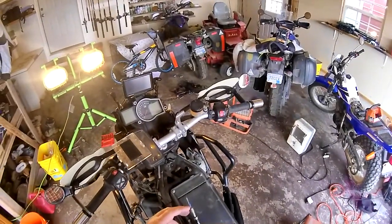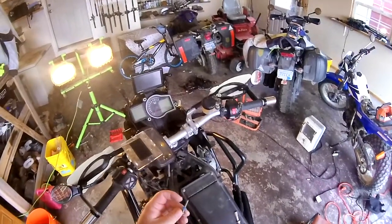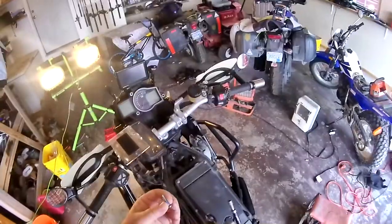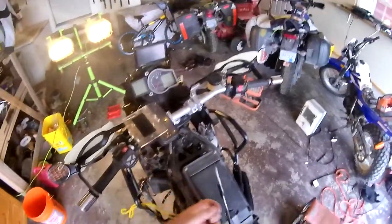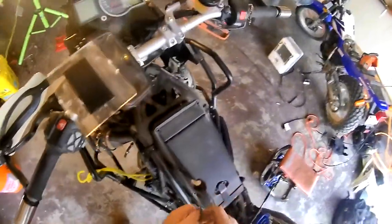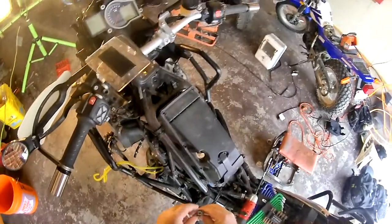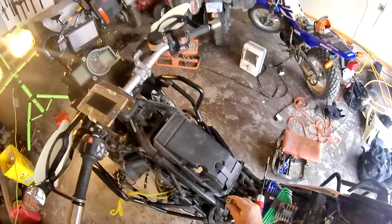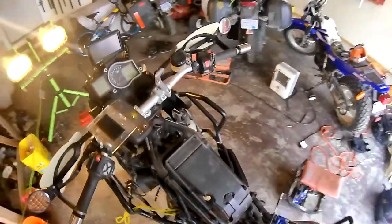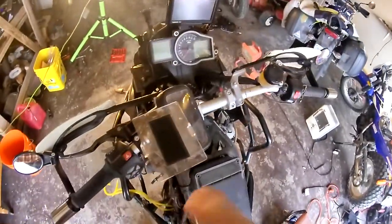You can see on the air box screws what's left from when I put the blue silicone all the way around — it definitely adhered to the screws, which is what I wanted. Take off the sensor by pushing and pulling it loose. Everything electrical like this I put a little dielectric grease on when reassembling, which makes it easier to get off. I'll need to use a box blade knife to go around the edge and break the blue silicone seal.